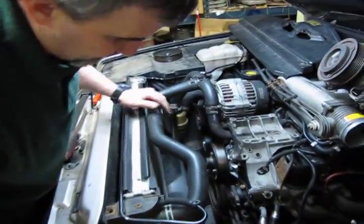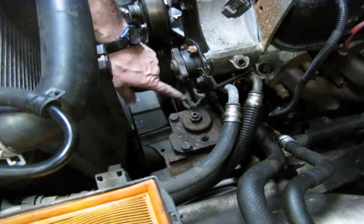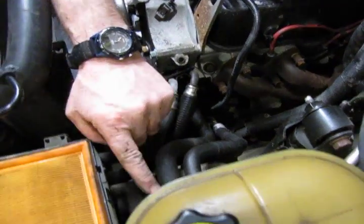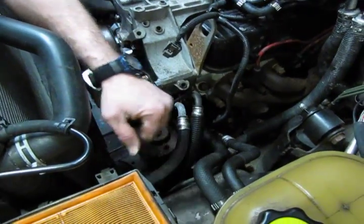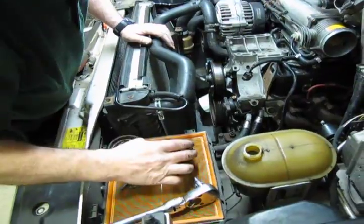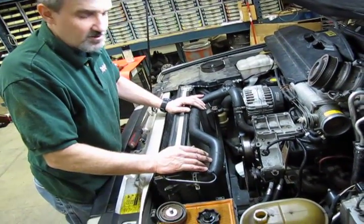We're going to disconnect the hoses from the pump. Now, obviously, when you do that, fluid is going to run down and you're going to be making a mess underneath the vehicle. You want to get a catch pan. I found that I like to take the return hose off with the pump. So we're going to disconnect the return hose at the reservoir and then get some rags underneath here, so when I pull this, what's in the reservoir will end up on the rags. What you could also do, if you have access to a suction gun, you might want to draw the fluid out of the reservoir before we start disconnecting. Again, that'll minimize the mess that you make.